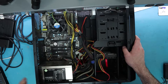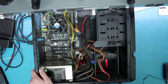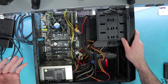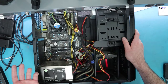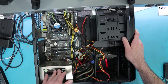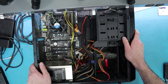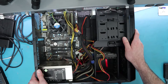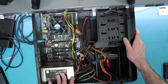This one is completely dead and we need to replace it with something of higher quality, ready for any games. If you're looking for RTX cards and want to upgrade in the future, a rule of thumb is to check the power requirements for your card. The newer NVIDIA cards are a lot more power hungry. If you're going 3060 and below, go with a 650 watt. If you want to go 3070 and higher, I would personally go with a 750 watt. For a basic build, a 650 or 550 watt is fine.